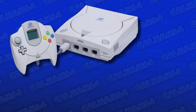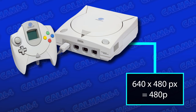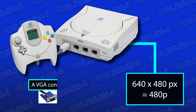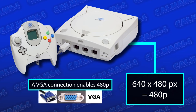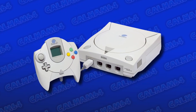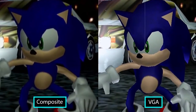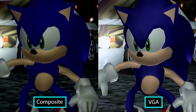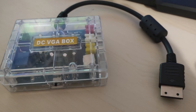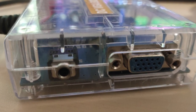Here is what the Dreamcast can actually do for video. The Dreamcast's best quality is a 640x480 image, resulting in 480p. It does this when a VGA connection or cable is connected. When hooked up directly to a monitor with VGA input, the results are really great. You go from a muddy display from your standard composite signal to a completely crisp and clear display. All you need is either a DC VGA box or a cable specifically wired for it, and the magic happens.